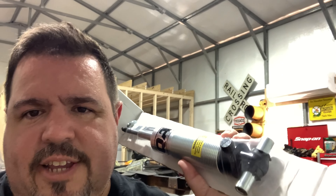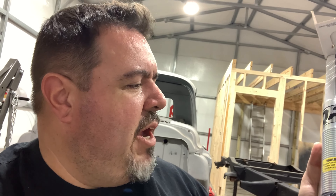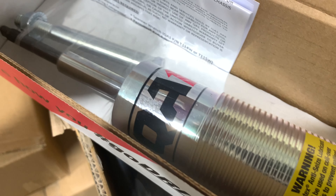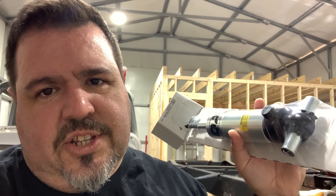Let's take a closer look at all the parts together. I showed you the crossmember and the top hats — I'm really pleased with those. They're all ready to be welded into that frame, really good construction. The QA1 coilover — I think these are really nice. I had Viking coilovers on my last build, which was a 79 Trans Am, and these definitely compare in quality to the Vikings. They feel solid construction-wise. These are single adjusting, so one knob basically adjusts your compression and rebound all in one.